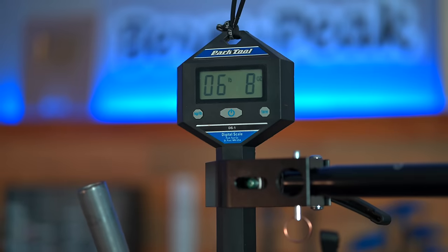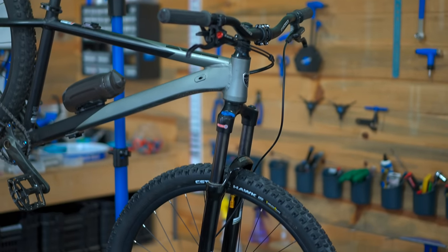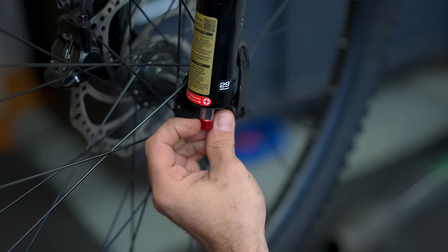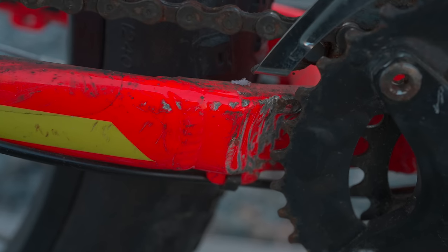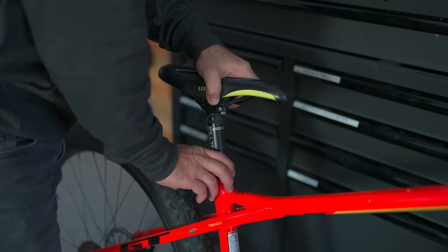From a performance standpoint, these work. I've ridden far too many bikes with XCT and XCM forks, and I can say from experience you are better off with one than without one. If these are such a great balance of performance and quality, why are so many people removing them? Well, because they're heavy and they're not very adjustable. A high-end suspension fork can cost $1,000 or more, but you can get a pretty decent entry-level air fork for $250 and save two pounds. For many consumers who purchase entry-level bikes and then progress, they want to set the sag, adjust the rebound damping, and get the weight savings — and for them $250 is well worth the upgrade. But in my opinion, on the list of upgrades you should be doing to an entry-level bike, this is pretty far down the list. You're much better off upgrading the drivetrain, the brakes, adding a dropper post, and maybe even swapping the stem before you spend $250 on an air fork.